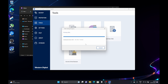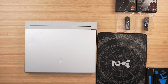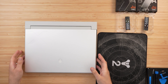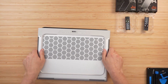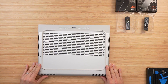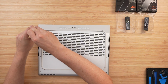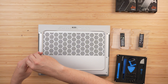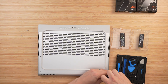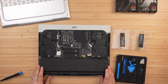Once the clone is done and you've shut the machine down — make sure you fully shut it down, not sleep — unplug the caddy and the power, then remove the base plate from the bottom of the laptop. I like to put a mouse mat on the table so I can turn the laptop onto it and avoid scratches. With the machine upside down, remove the six Phillips head screws. Note that on the X16, the front left and right screws pop the base plate away as you undo them, giving you a little area to pry it away. Put your thumb into either corner and pry the base plate off, giving you full access to the SSDs.